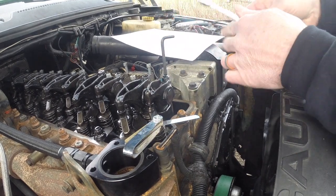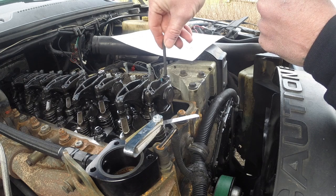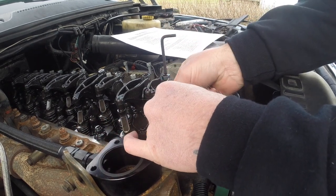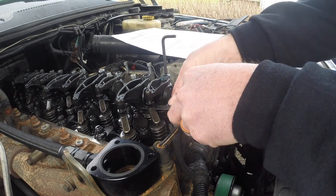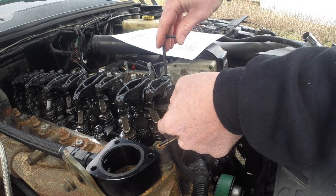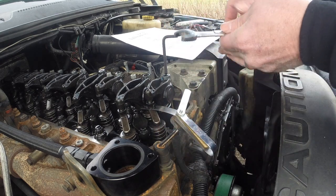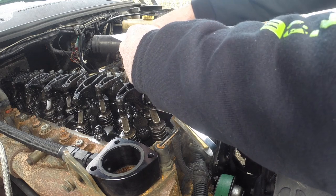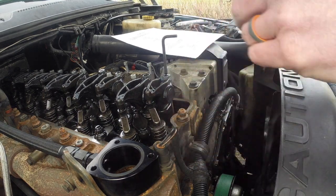Those are really tight. You can turn this to loosen everything up — you can see how that valve is going up and down. You just want to turn that until you get drag on your feeler gauge. You can feel it — if you go too tight you can't move it at all, so back it off just a little bit and tighten until you've got just enough drag. That's pretty good right there. Hold onto your allen wrench and tighten everything up, and you can see how I have just enough drag on that one.